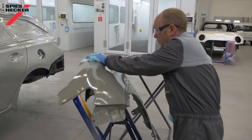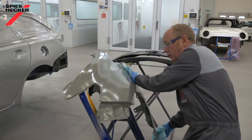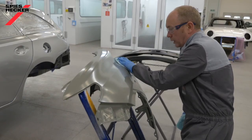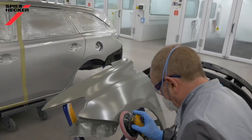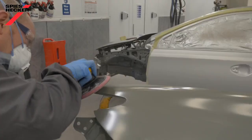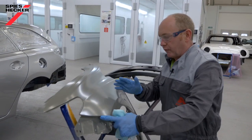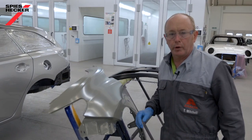To do this, all I need is to simply clean the panel and inspect it, and if everything's okay I can apply my primer surfacer directly to it without any sanding — that's one of the major advantages of this product. If there is some damage, all I need to do is sand locally, and if I go through to bare metal, don't worry too much as this primer surfacer has good anti-corrosion properties and is particularly suitable for small areas of sand-through. That said, if it's a whole panel taken to bare metal, I would look for a different solution as this would not be the right product in that case.